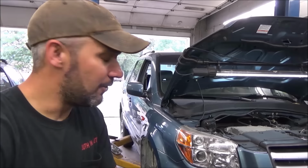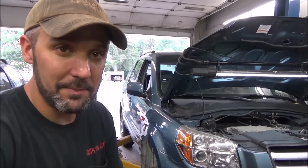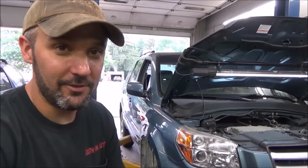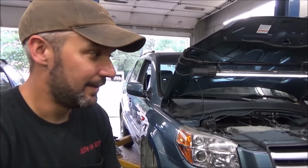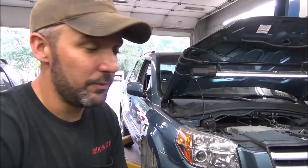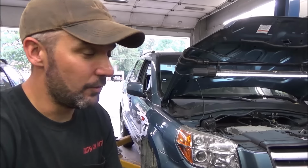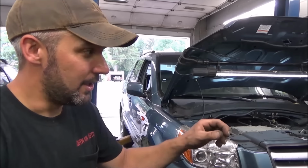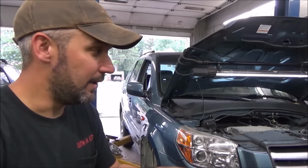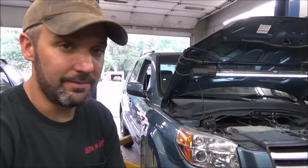And I know a few of my methods are probably a little unorthodox as far as chopping the timing belt and pulling the pump off and letting the water go, but I've done so many of these and so many different timing belts, and I just figure, well, if the belt's junk, then fine. And I don't know what job you would typically do in there where you would actually reuse a timing belt anyways. So I see no need to actually follow the book and take the battery bolt off and thread it in and hold the tensioner and take the belt off. Frankly, this way it works.